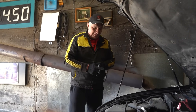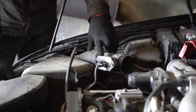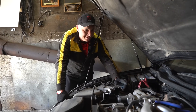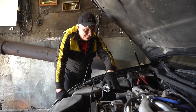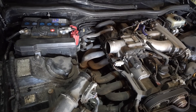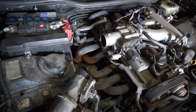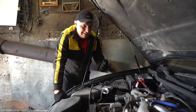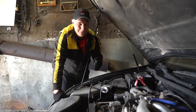Here I've begun the teardown. And here I found this lovely mass airflow sensor — it measures the amount of air going in. And this somewhat crazy idea occurred to me: maybe I shouldn't tear all of this down. Maybe I just leave the throttle body assembly be, leave the cable as well as these servos that adjust stuff, and fit the carburettor right here. Leave it fully open, and leave it to the throttle body to modulate the amount of air mixed with the fuel entering the engine via this carburettor. Maybe I'll even be able to keep all of this on.